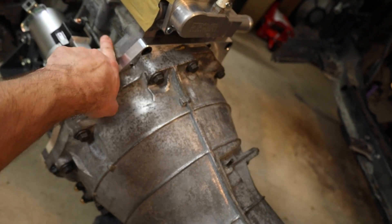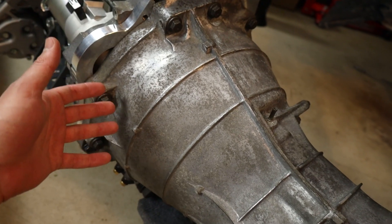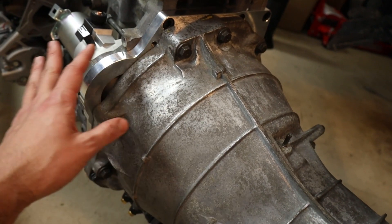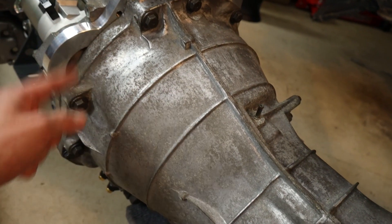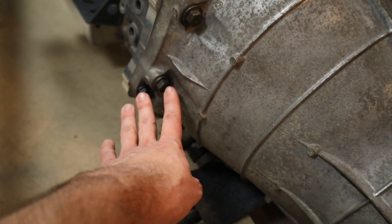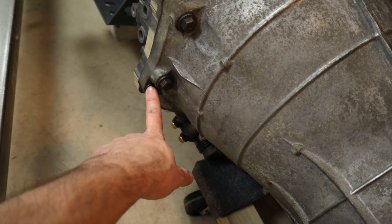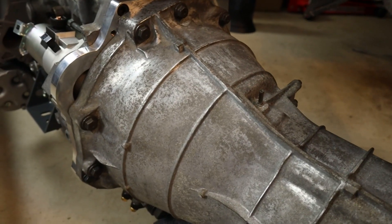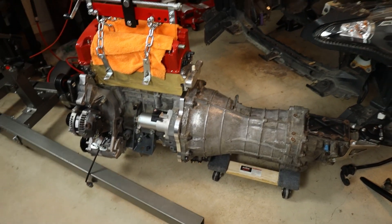Getting the input shaft to slip through everything to get through the front here was a lot of work. I actually wasted a ton of time because the adapter kit from Collins doesn't include any instructions, or even which holes you need to use and which size bolts go in which holes. There are two different sizes: M12 — five of those across the top — and then two M10 bolts, one here and one on the other side down near the bottom. But anyway, I'm just happy to finally have all of this in one piece.